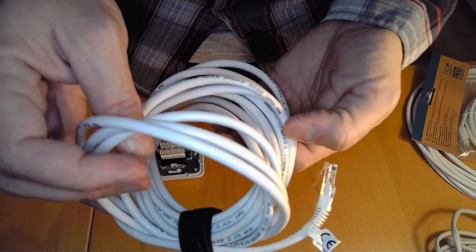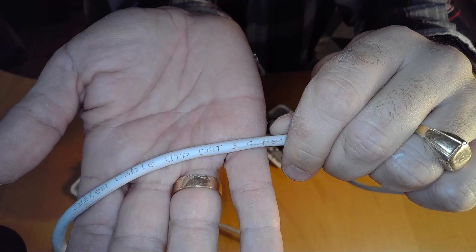It's a bit of work but it will make your PC connection a lot better. You can also use power-line extenders — I don't recommend them because they can reduce signal strength quite significantly — but you can try it. Getting your PC cabled is the first priority. When connecting your PC, make sure you're using a Cat 5e or Cat 6 cable for optimal performance; it's usually labeled along its length.